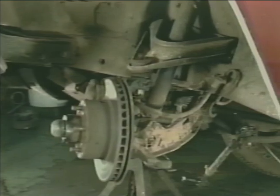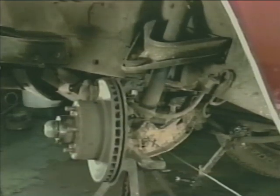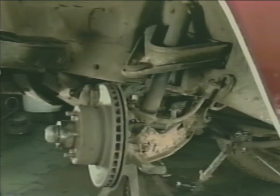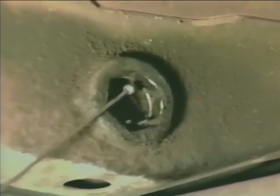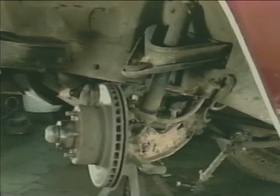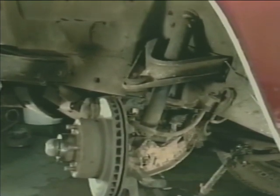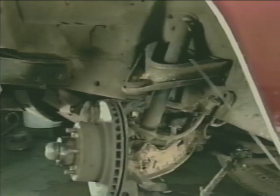The torsion bar takes the place of the coil spring that we looked at in our previous suspension. It controls the weight of the vehicle by preloading from a tension screw and the twisting action brought upon it by the upward and downward travel of the control arm. That is why the torsion bar is mounted to the center pivot of the lower control arm. The rear of the torsion bar is mounted in a fixed socket in a cross member further back in the chassis. The last major difference in this type of suspension is the fact that the upper control arm adjusts caster and camber through eccentric cams instead of shims.